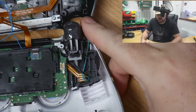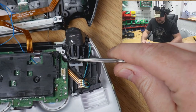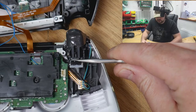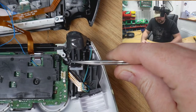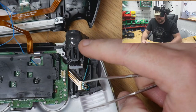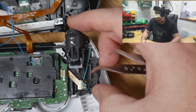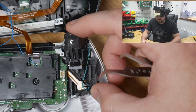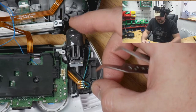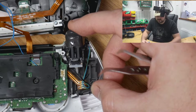Here's the working left trigger. We have the switch — that little white thing there is the actual plunger, that's what makes the click. And then we have this retainer here; this is a standard PS4 trigger. As you can see, it just hits that plunger. There's a little bit of play before it hits it, and then click.